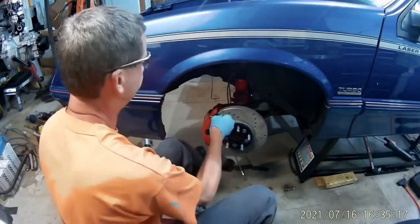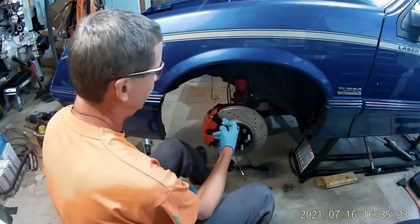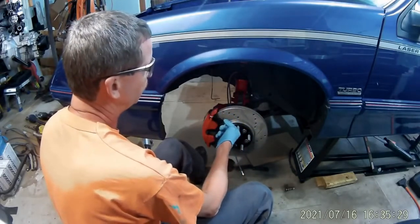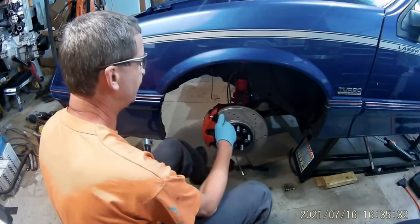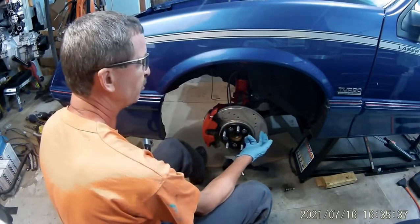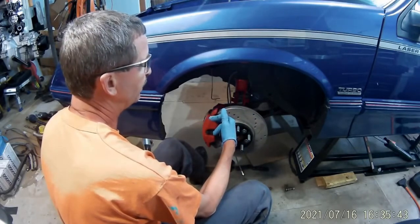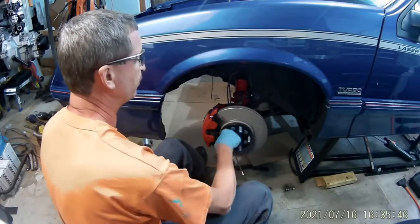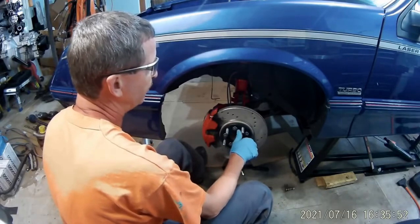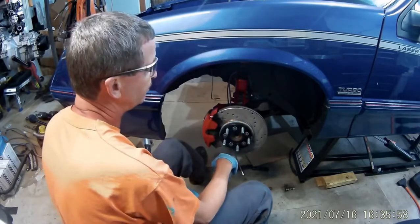This noise tab is supposed to be on the incoming side as the wheel turns, so whenever you're positioning that, make sure it's on the incoming side. Same goes for the vanes on the rotors — they're supposed to face with the direction of rotation so that as the wheel turns, they're biting into the air. I can't tell you how many times I've seen them the other way; for years I did them backwards. But I've done research and this is the way they say to do it.